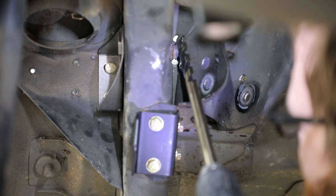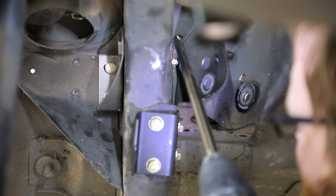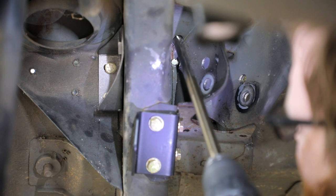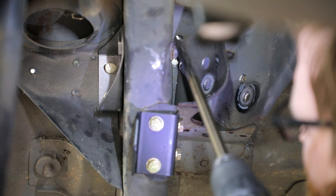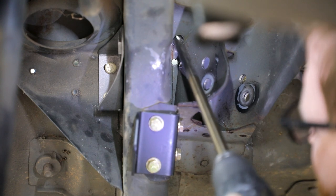Clearance the sheet metal around the drilled holes under the doubler plates using a 1/2 inch extended length drill or die grinder with a carbide burr. You will need to make room for the 1/2 inch OD crush tubes to fit against the backside of the doubler plates.